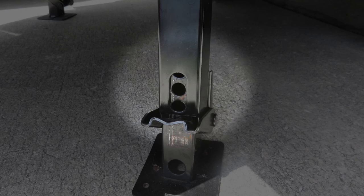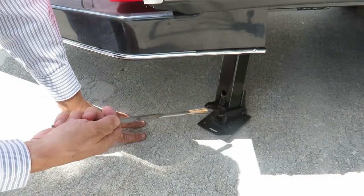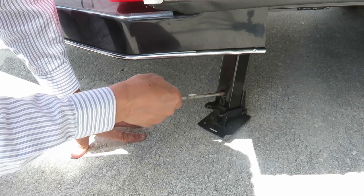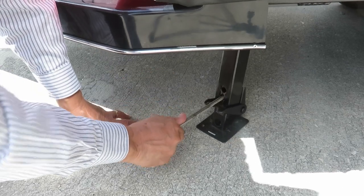The first enhancement comes from Be The Rider PA and is worth repeating — be sure to check out his channel. There's a half-inch hole in the support legs of the timeout trailer. You insert a half-inch bar through the hole to jack up the trailer when you are leveling it. This is a half-inch masonry bit I found in my grandfather's toolbox and it works perfectly for jacking up the trailer.